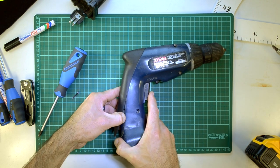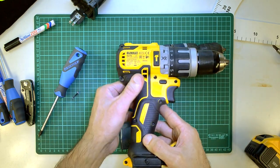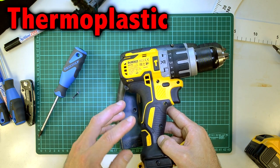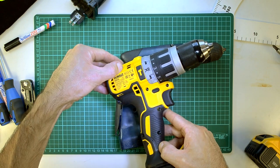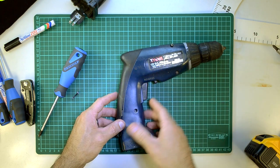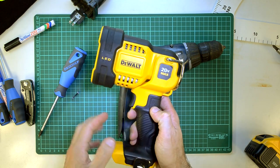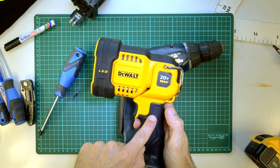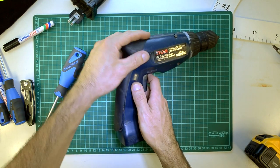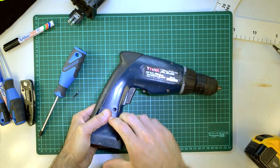She's got this kind of plastic - it's not really an over-molding. If you have a look at these drills nowadays, these rubber over-moldings - I think they're TPE over-moldings, thermoplastic elastomers. They are actually molded onto the plastic, into the plastic itself. You can check it out in one of my other videos where we took apart a drill - you could actually see the plastic or the TPE was molded and stuck to the plastic itself. This over-molding is just clipped on. I think we have to get it off to be able to open this drill.